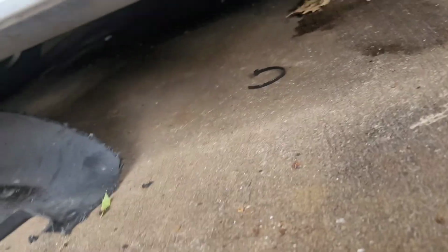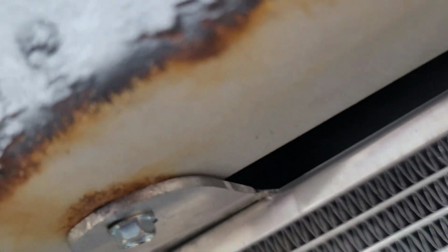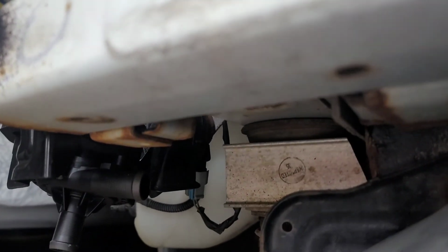you get you some self-tapping screws, okay? Like these. And what you're gonna do, if you look at the bumper support on the bottom, there'll be one hole, two, three, four, five, six, seven, eight. Okay? So you want to go to the fourth hole. Have it centered. One, two, three, four. And it's the same over here.